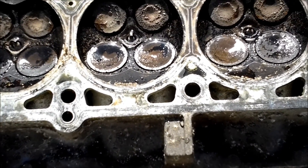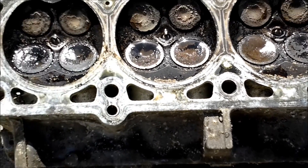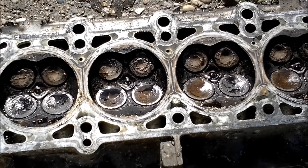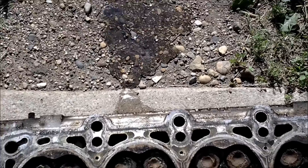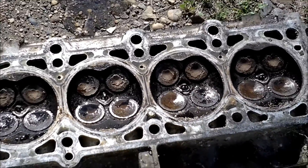This won't always happen. These apparently are very, very bent. But normally, when your valves aren't bent to this extent, the seal they get will provide a problem when you're trying to leak-test them like this, because the water won't flow through — surface tension will keep it from flowing out.